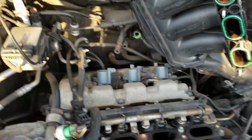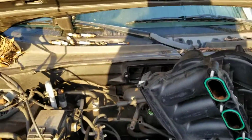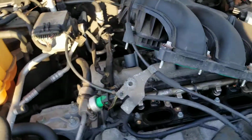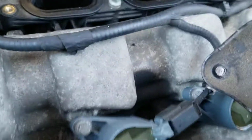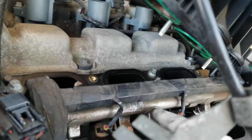So let me go ahead and do the back, put the bolts on, put the intake on, everything back on, and then the computer. Computer goes right there. Okay, now the coils are bolt down, plugs are plugged, same in here, front and the back. Make sure 1000% sure everything's plugged in before you install the intake back. So make sure everything's plugged. I'm checking everything is plugged, so we're good to go.